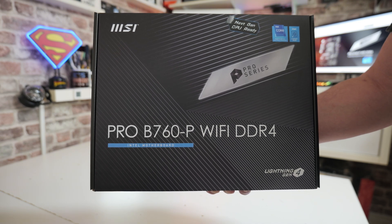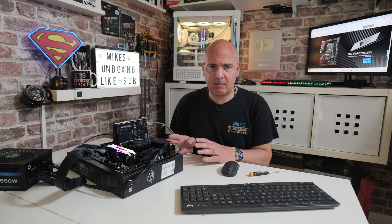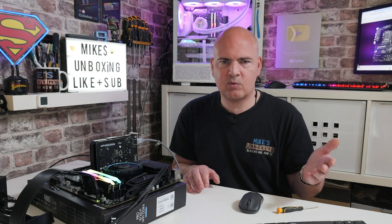This video is going to show you basically how to do it. You don't have a BIOS flashback button on this board, so you will need to have a working processor in the motherboard to begin with so you actually have a display. If you've got a problem where the motherboard isn't recognised by your processor at all, then potentially you've done something wrong. This board from the factory actually supports every single LGA 1700 socket processor available at the time of making this video, which is June 2024. So everything from the early 12 series right the way through to the 14900KS — all are supported on the day one BIOS.